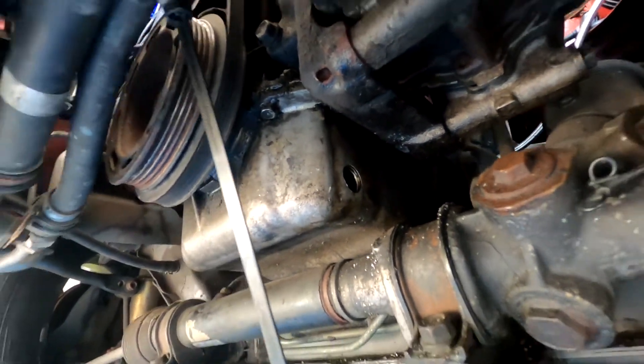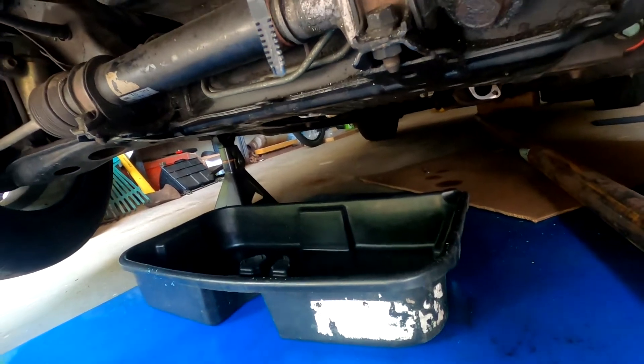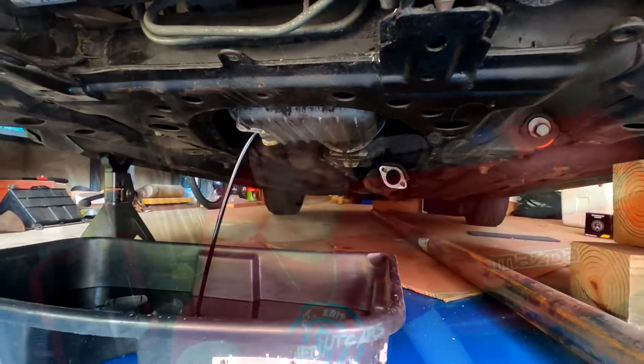It's the next morning. That looks really good now that I can actually see it well — I'm happy with how that went and that fitting threads in pretty nicely. The next thing is to drain the oil and flush out the pan. Slight change of plans though — I sat there putting grease on my finger on a glove and reaching into that hole trying to get out all those chips, and I got it to the point where I really can't feel any more shavings. So I'm actually going to skip flushing out the pan. A lot of people flush with mineral spirits, but I think I did a really good job getting the chips out with my finger. I just put a brand new oil filter on and there is the screen on the oil pickup, so any chips really should get stuck in that and not go up into the engine. If you're overly worried, you absolutely can flush out the oil pan with mineral spirits.